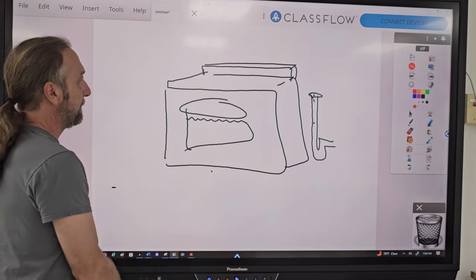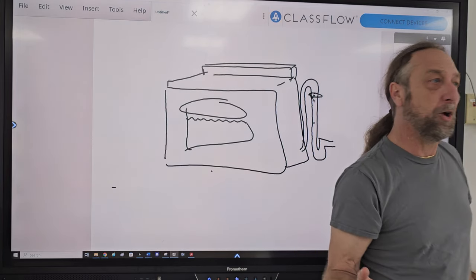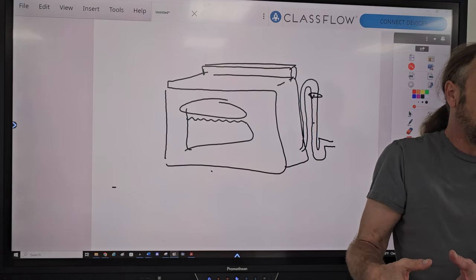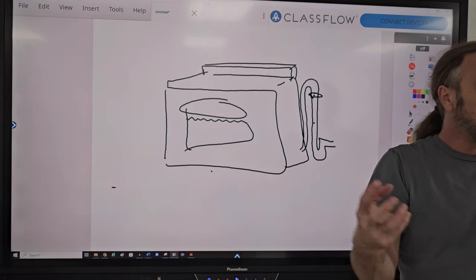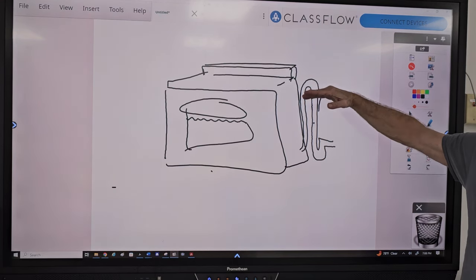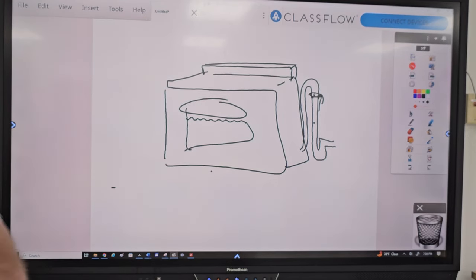But here's another thing. Sometimes people take the drain hose and they stick it in the drain pipe, and it is higher than there. But they have a problem. They live in a very old home, and they probably have a septic tank or very old plumbing. You know, some of these homes have galvanized pipes instead of copper or PVC, and the pipes start corroding and breaking down. Trees start to grow roots in them and everything else. So water will leak here because as it's draining, it's backing up and overflows onto the floor. So you know what a customer does? What do you think a customer is going to do? They got water leaking on the floor from that pipe. What can I do to stop it from leaking that water?